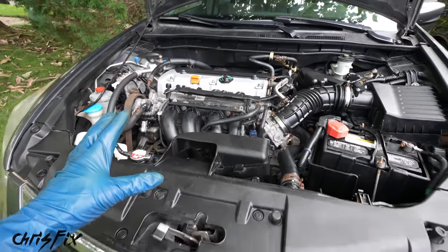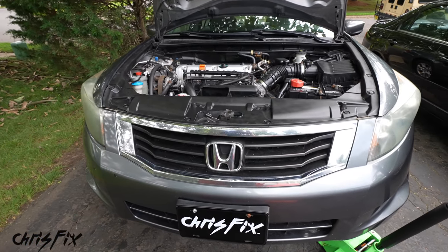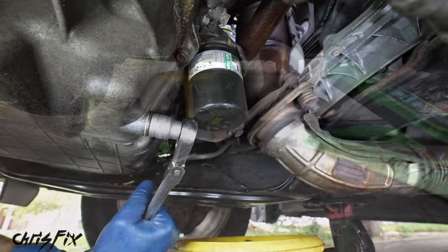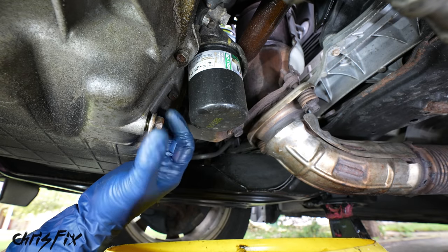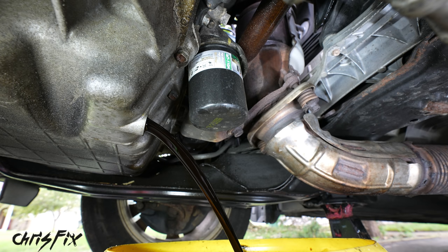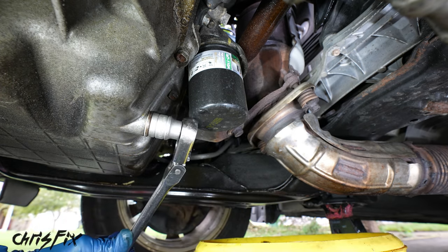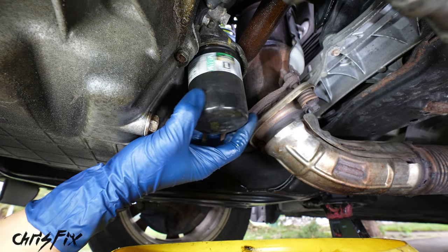Now in this car, I'm gonna be doing an oil change. You don't have to, but it's at 15% oil life, so it's worth doing to finish this project off. So let's break the oil plug loose, and let's see if we could remove this without making a mess. Pretty good. Now you're gonna let all the oil drain out, and once it's drained out, snug up that bolt, and don't over-tighten it. Now let's remove the oil filter,